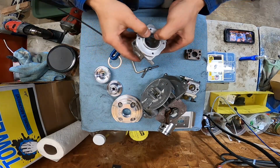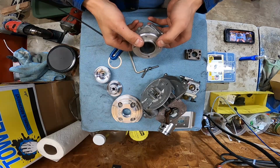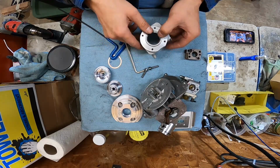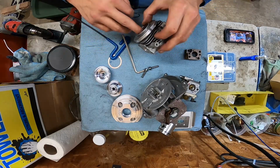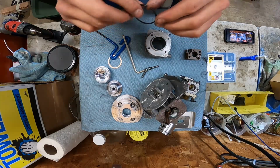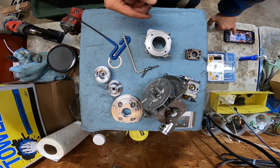Yeah, I can't even straighten it up without the ring hitting. Okay. Ring gap needs to be, ooh, Jesus, don't slide out like that, Aaron. This ring gap needs to be opened. Alright, let me grab a file. Hang tight.